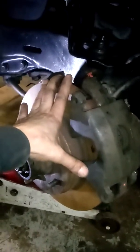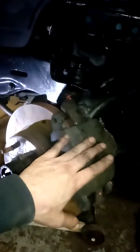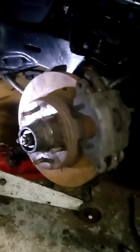But all this is in, everything's tight, ball joints are not loose. Now I'm just gonna take it all back apart so I can clean everything. I only grabbed one spindle, just the one side, just to make sure it worked — no sense ripping out two sides if it doesn't work. You can use your same pads and everything for the 70-78 early or late A-body cars. Pads are the same, caliper is the same, everything.